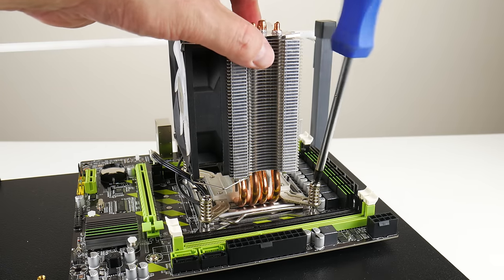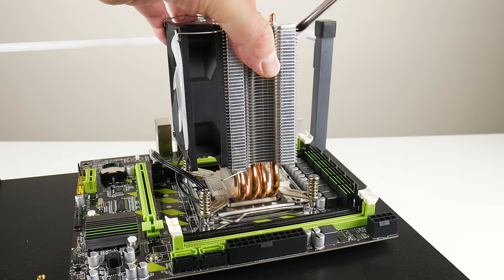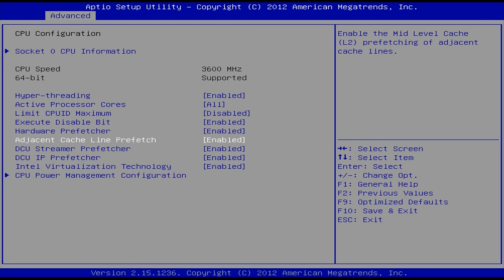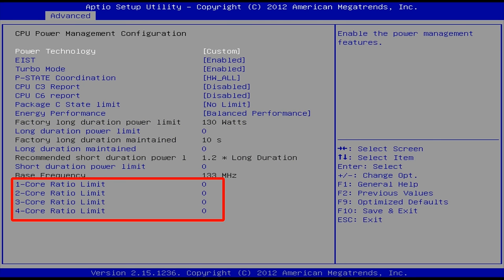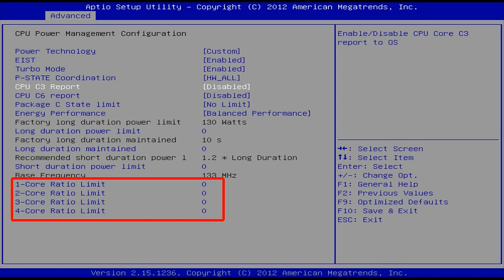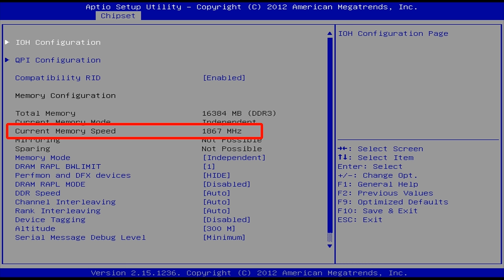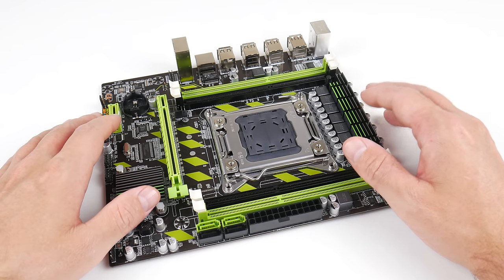Because the processor is fully unlocked, we can go into the BIOS and overclock by changing the CPU multiplier. 42 is the highest, so it will overclock to 4.2 gigahertz. With the RAM, I'm using 1866 megahertz, and the CPU also has an unlocked RAM multiplier, so we get to enjoy some faster memory as well.